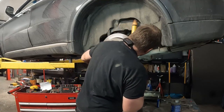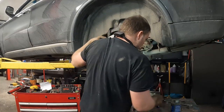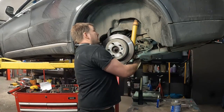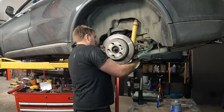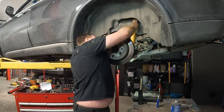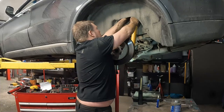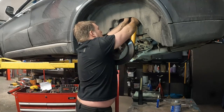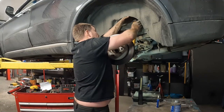And the other thing that's nice about screw stands is you can kind of play with your height. Anything like this, always put your through bolt in first, because it's easier to line up your top bolts than the through bolt. And just put the nut on there just to hold it. We're not tightening anything. Now, the other bolt.